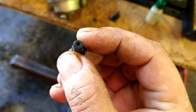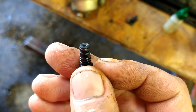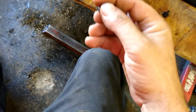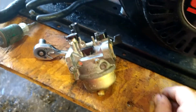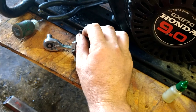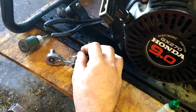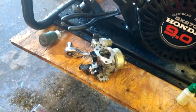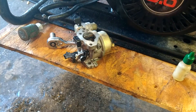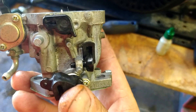Spray through the idle jet really well — make sure it sprays out through all the holes. Pop it back in: there's a flat spot, line it up with the wall, push it all the way down nice and tight. Put the triangle-shaped cap on top, push it down tight. For the idle screw: on a generator it doesn't matter much, but on other equipment screw it all the way in, bring the machine to idle, then turn it out counterclockwise until you get a good idle. For this application, set it at the halfway mark.